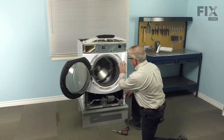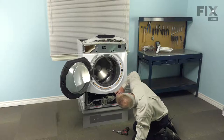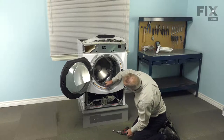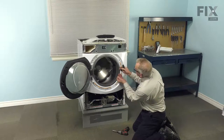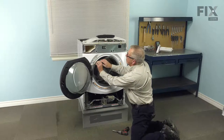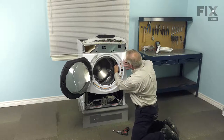Now we need to release the bellows from the front panel. There is a wire band that goes all the way around it to hold it in place, with a spring on the very bottom. Using a flat blade screwdriver, go into the loop on the end of that spring — make sure you have a nice firm fit, or use a pair of needle nose pliers — stretch that spring enough to pull the wire out of the opening, remove it and set it aside, then peel the bellows away from the front panel and tuck it in behind.